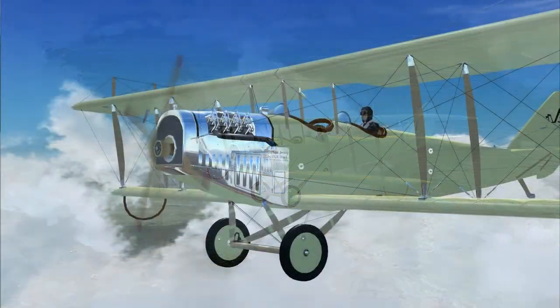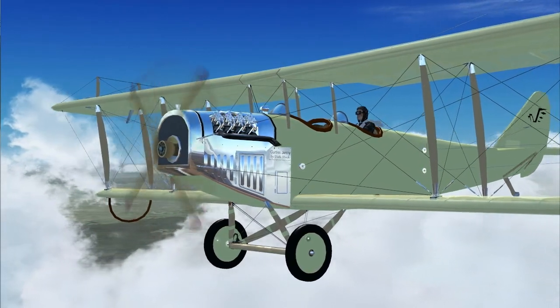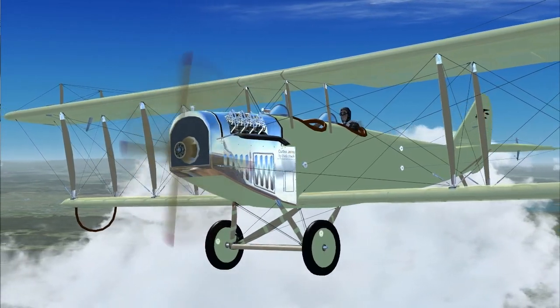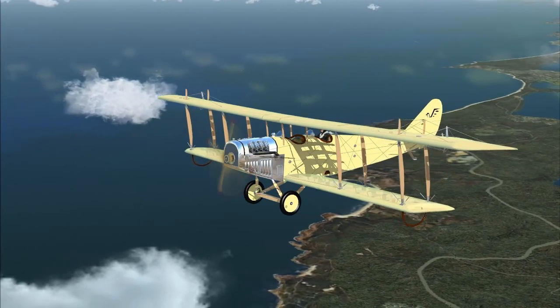We're only interested in the front end of this aircraft because it's built around a Curtiss OX-5 engine. The OX-5 was a water-cooled V8, produced a fairly paltry 90 horsepower, and was pretty unreliable thanks to, among other things, its exposed valve gear and a single magneto ignition.